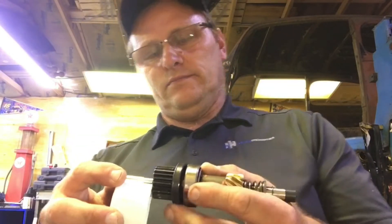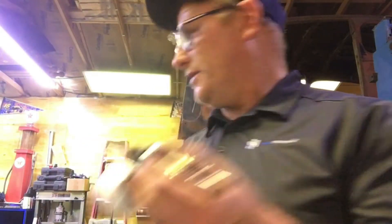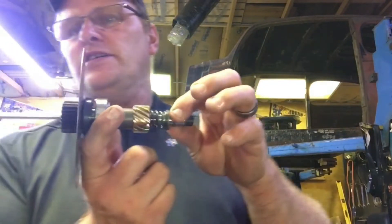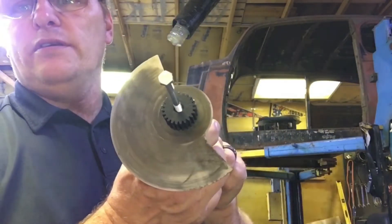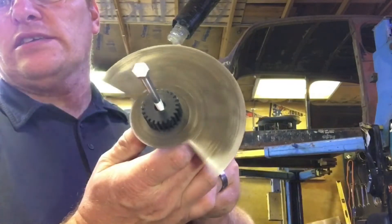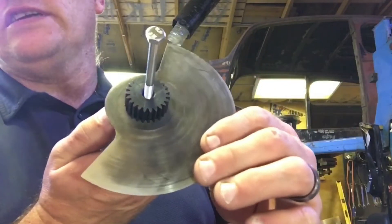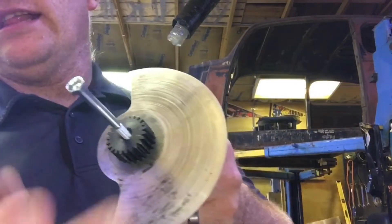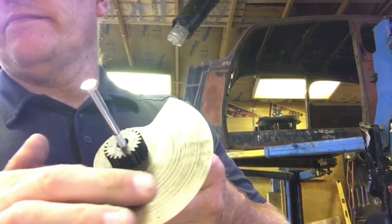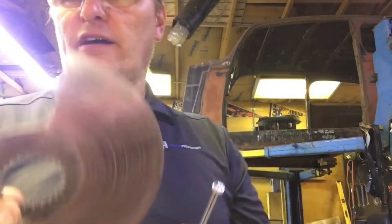Really interesting thing on these Sea-Doo boats — let me show you the rotary valve. This slides on a gear that's attached to your crank. When this spins around it goes past each port — air, exhaust, and intake — as it goes around. As this disc turns, it opens and closes each valve. You can see these scars on this plate; once these grooves get deep enough you're getting a lot of blow-by. What happened is when the brass gear's teeth chewed up, some of that got spit through here.